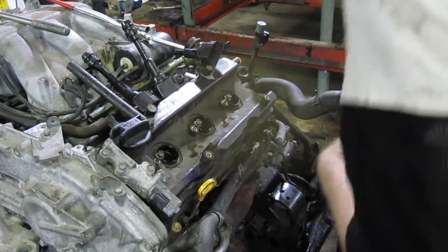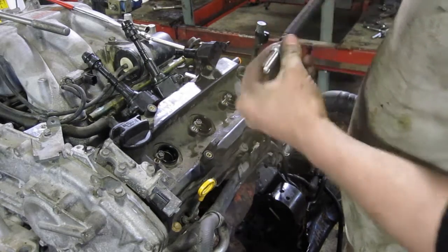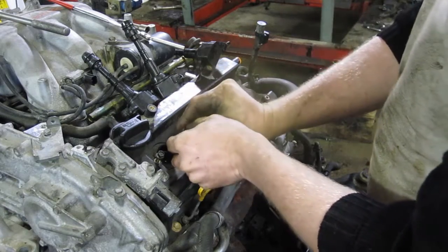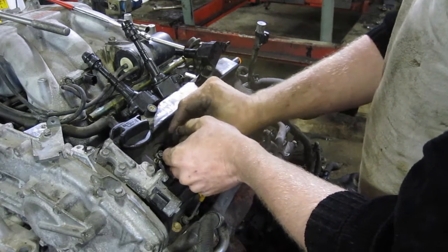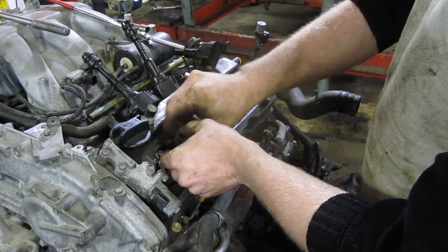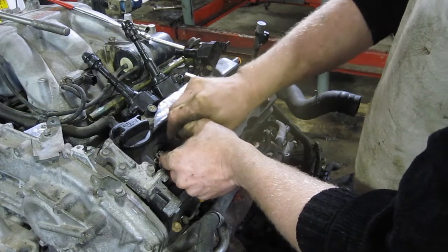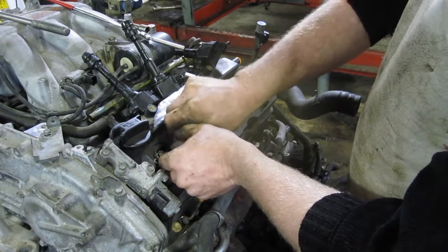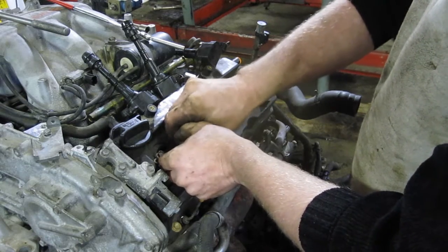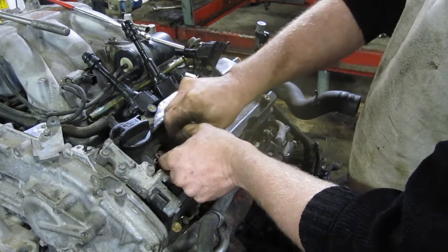That blowout issue was common for early 2000s Fords. They then decided to put 12 threads in there holding the plug, thinking that would fix the problem. But your plug is steel and the head is aluminum, and they oxidize together. When you go to change your plugs at 120,000 km, you end up with the top half of the plug in your socket and the bottom half corroded into the engine. That was a problem for a few years of manufacturing before they figured it out.